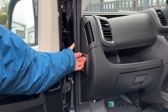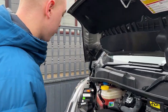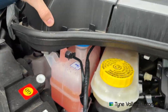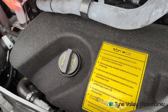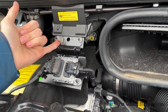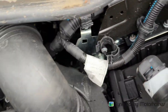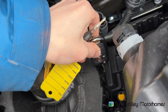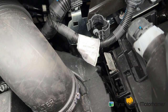To open the bonnet on a Fiat Ducato, located beside the passenger door — open the door and you'll get to the lever. Pull this down and open the bonnet. Once underneath the bonnet, you have all your fluids. The main one you're going to need is your screen wash, located here. Lift this part of the scuttle off and you can fill your coolant. Next to it you have your brake fluid. You've got your oil filler. Your earth for giving or receiving a jump start — this is where you put your black clip. And you put your positive red clip by using the key or anything flat — pop this here, pull this back, it just unlocks it because it's on a strong clip. Put your positive there for giving or receiving a jump start.